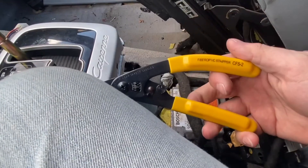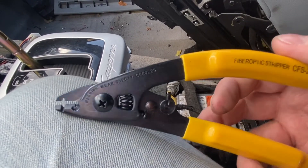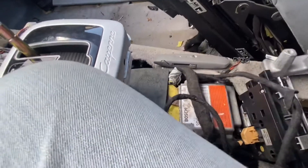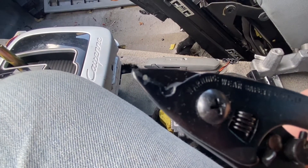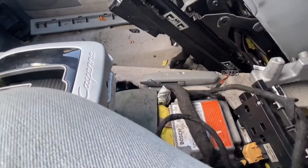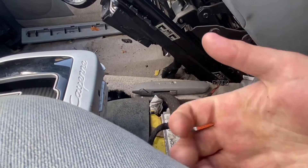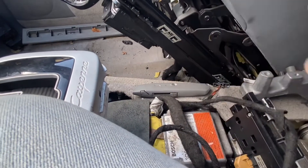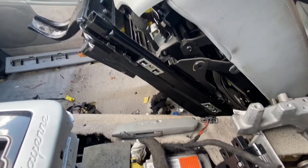You'll need these — they're a fiber optic stripper. I bought these from Amazon; they came with a bunch of other stuff I threw in the garbage, but this is the main part. You can get away without this — you can probably use wire cutters that have holes in them to strip it back — but it won't work unless you have that style. Don't try the quick squeeze ones that strip wires fast, because they won't cut through the plastic ending.